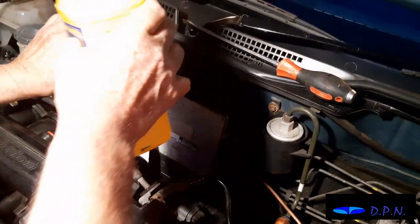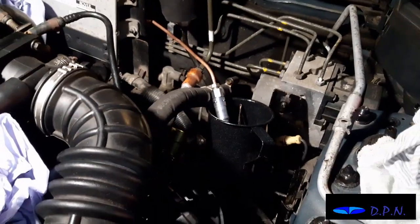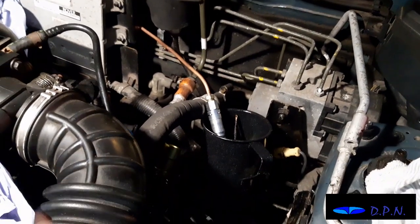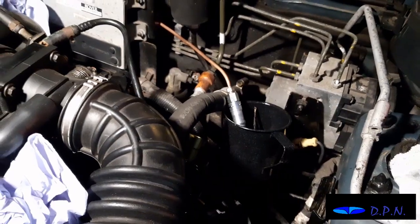Right, so we're just topping up the reservoir again, and hopefully you just see there the process of it coming out this end. You've seen us pedal in, and this end as we get the air out. Right, so although it's not took lots of fluid, we think we've put in as much as we can, and we've got a good chance of getting any air out. So there, we're not really seeing lots of air coming out.